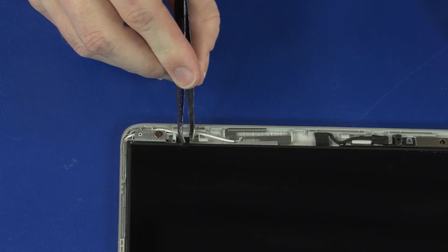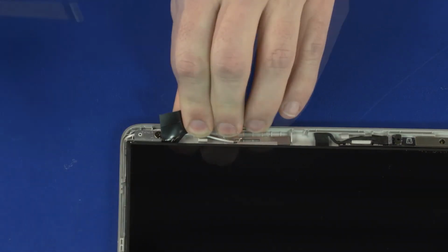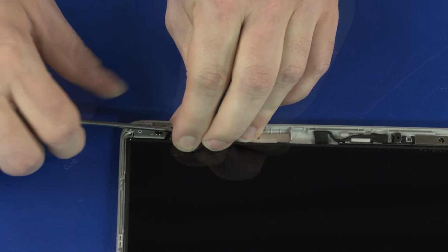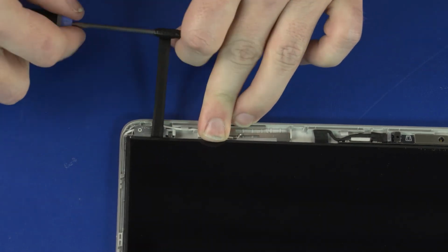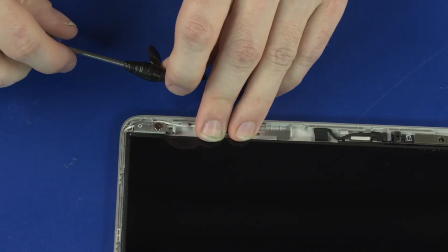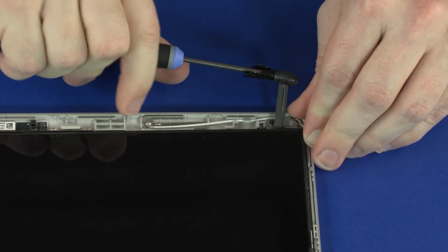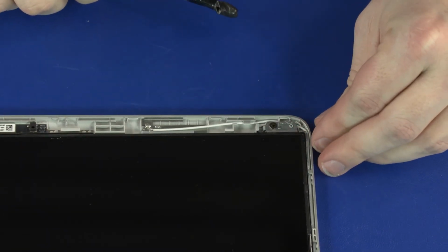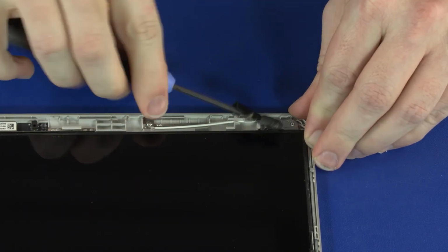One at a time, grasp the pull tab of each strip of tape and carefully wrap it around the end of a cylindrical tool, such as a screwdriver. Slowly twist the tool to release the tape. Continue twisting until the entire strip has been removed. Important: if the stretch-release tape strips are pulled too quickly or at an extreme angle, they will break before releasing the display panel. Note: the removed stretch-release tape is not reusable.